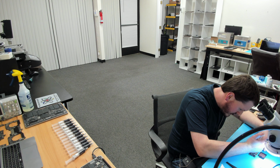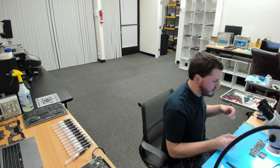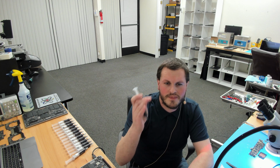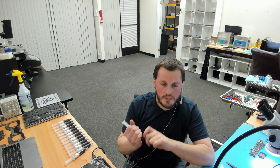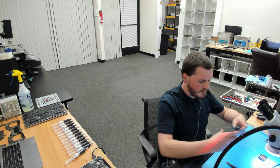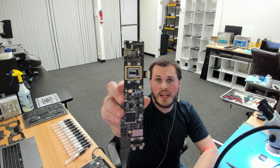And a little line down the center of the PCH die. Okay, and that is the proper amount to put on. Generally with this applicator on the syringe, you just squeeze a little bit and it will come out, and just drag that along the CPU die, and you'll get the perfect amount on. You won't get too much and you won't get too little. You don't want a big glob on there, but you should have enough. And what that's going to look like is something like this, okay? This is the recommended application amount and method on any of the 2-die CPUs on any of these devices.